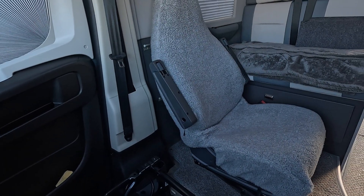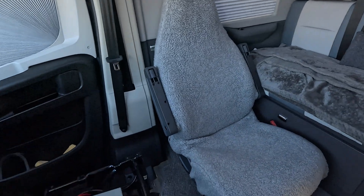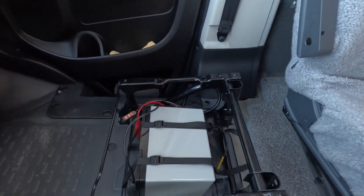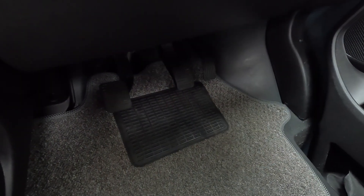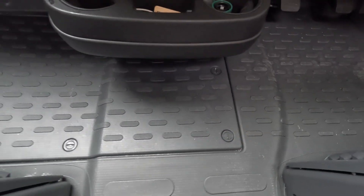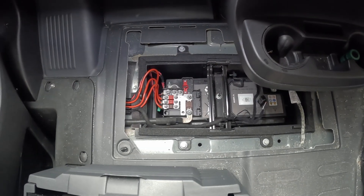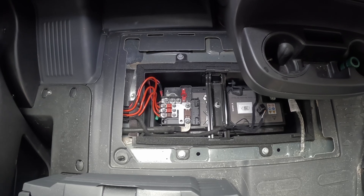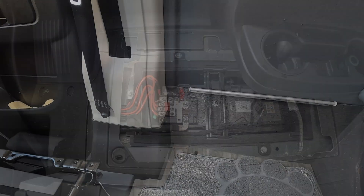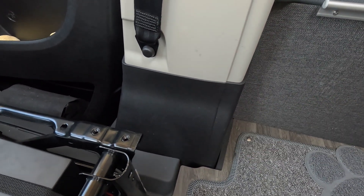Make sure you've had your Weetabix as the seat's quite a heavy lump. With the seat removed you get a much better look at the leisure battery in position. To gain access to the vehicle battery we need to remove the front carpet and the floor cover over the battery — with that removed you can see the vehicle battery that lives under the front passenger-side cab floor. We're also removing the lower B-pillar cover, as this is where our new relay is going to be fitted.